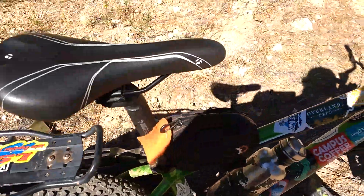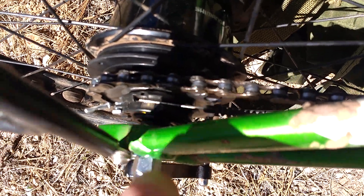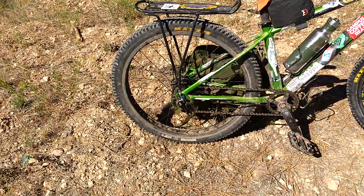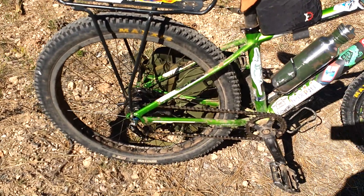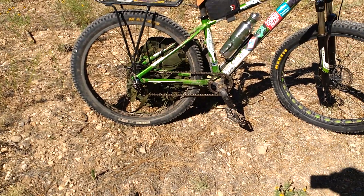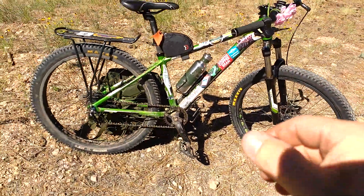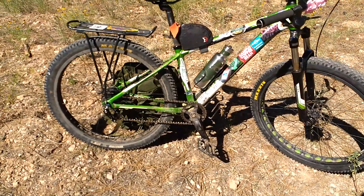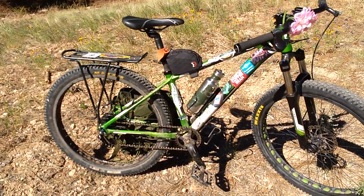There's a little indicator here — you put it in fourth and you can look down and see two little yellow indicators where you can kind of ballpark the gear. I've been trying to adjust it myself and keep it running as best as possible, but it's kind of hard because internal gear hubs require a touch for it. I went on a little road trip, put the bike in a rental car, and when I put the back wheel back on it didn't work right. When I was in first gear and tried to shift down, it would click. I took it in to the shop when I got back and it turned out there were metal shavings, so I had to have the internals replaced for the second time in a year.